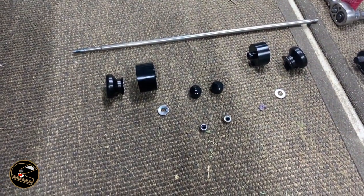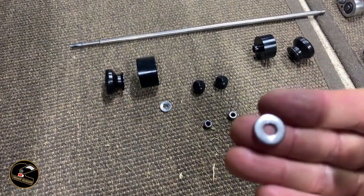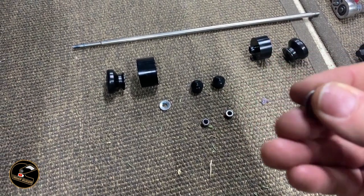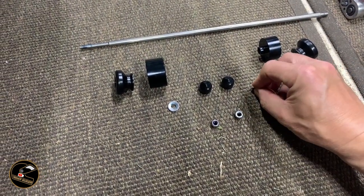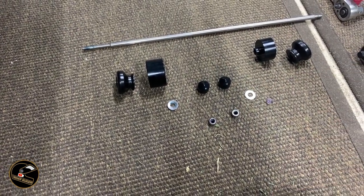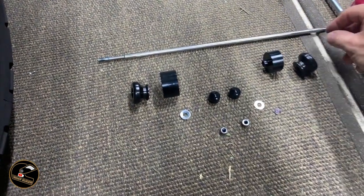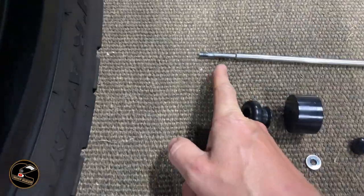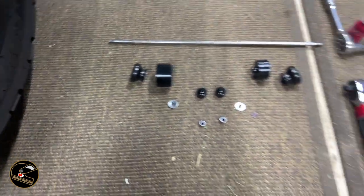Now, being apprentice-trained and a bit of an anorak, there's a right and a wrong way to fit a washer. It's how they press through sheet metal — there's a sharp edge and a smooth side. So being anal, I like to make sure that's correct, and I install it with the sharp side of the washer inwards. As you can see, the thread on this end is actually smaller, and you've got a longer edge with the thread on the other end — that's the left hand side of the bike. Remember all that.